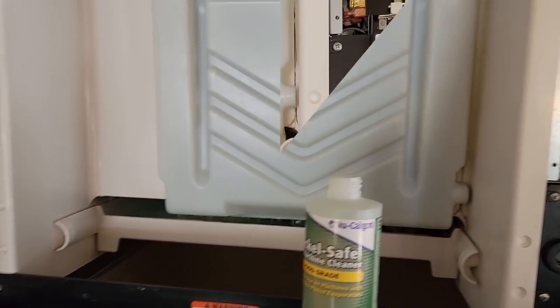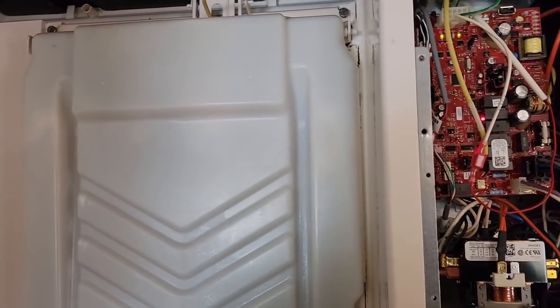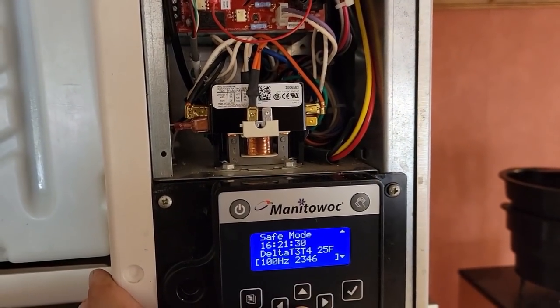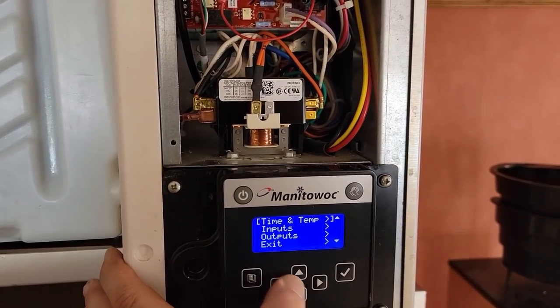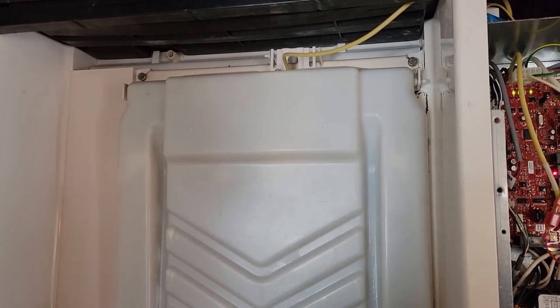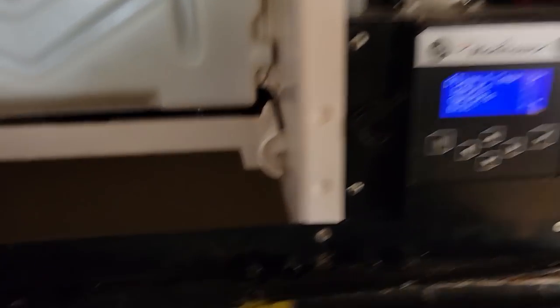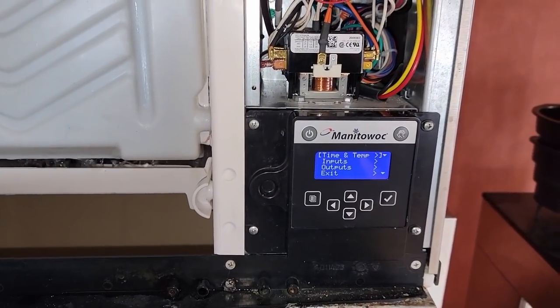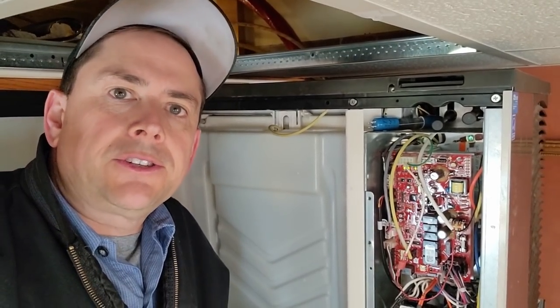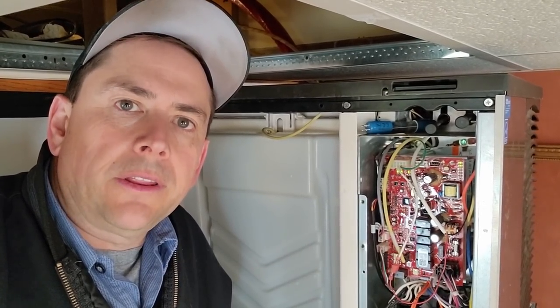See it's washing — let it do its thing. Still on harvest, it's trying to drop. The ice sensor needed to be adjusted; it was getting to the point where it's clicking and that's not good. It's working — but like I told the people, you need better ventilation in the building, a better water filtration system, and you might want to consider replacing the machine. It's Friday and we made ice — everything looks pretty normal. If you enjoyed the video and want to see more, subscribe, hit that thumb button, check us out on Instagram and Facebook. Until next time!